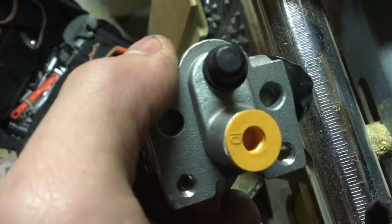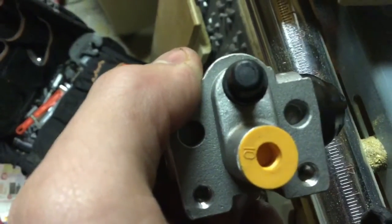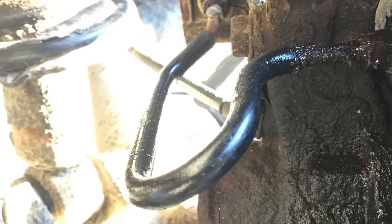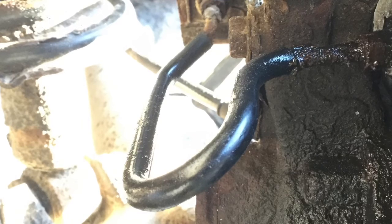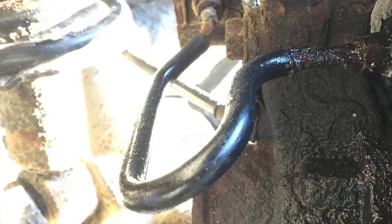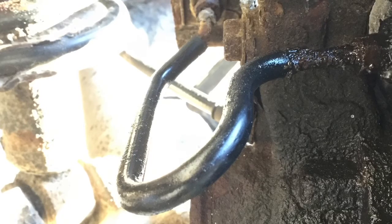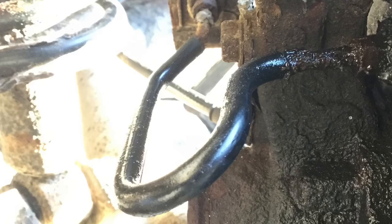For me it was a little bit different. The part of the brake line right before it goes into your wheel cylinder goes into a little black horseshoe shape, covered by a plastic or rubber coating. Water gets trapped underneath and it can rust through it, and on the very right side where the rubber is worn away, there's a hole in the brake line. It was spraying out like a squirt gun so my pedal went right to the floor — that's why I knew it was a brake line problem right away.